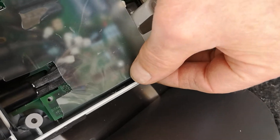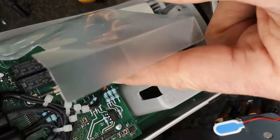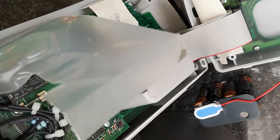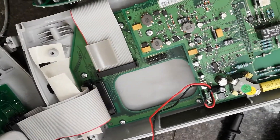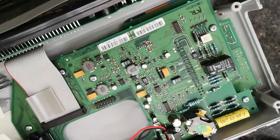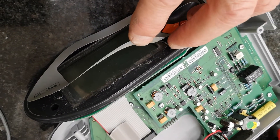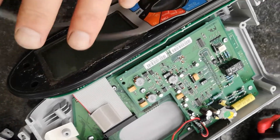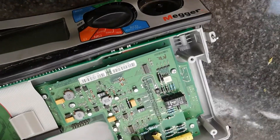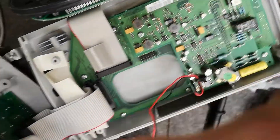This plastic sheet was just glued to the outer case to protect the components, as there's a bit of input on the voltage side. In order to get the thing apart, it's quite simple really — there are the obvious screws on the back, plus one under the warranty badge. Then I used my heat gun to warm up the adhesive on the top label, and there are two screws at each end to enable you to remove the top panel, allowing the two halves of the main body to separate.